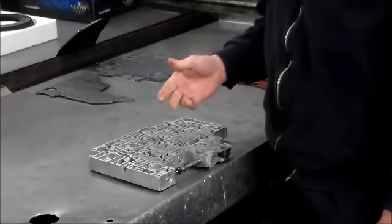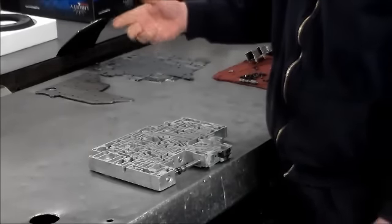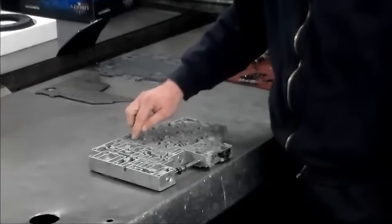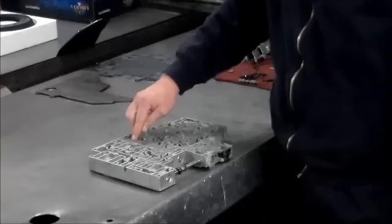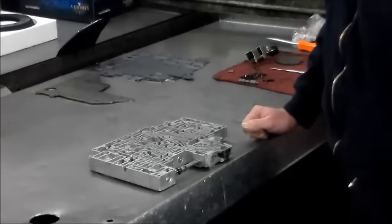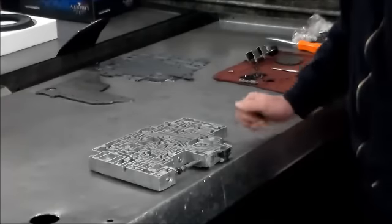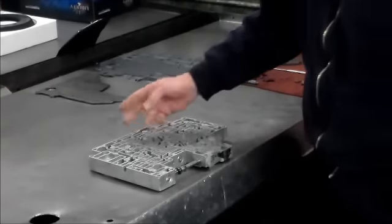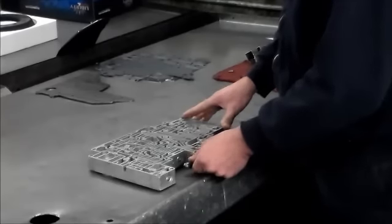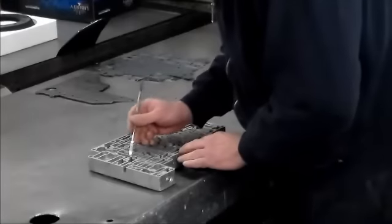A lot of times you'll be going through these trains, you'll get up to the point where the overdrive servo says, hey, I got no fourth because the snap ring is broken and the servo fell apart. Okay, great, you put it all back together, you got the same problem, because a piece is stuck in here restricting the movement. So that's something else you want to watch out for if you have that condition. I help out some shops in the area, and a couple of them had called me, and I said, you've got to look at your overdrive regulator valve because there's probably something stuck in it, and sure enough there was. Okay, so we're going to make sure all these valves are free.